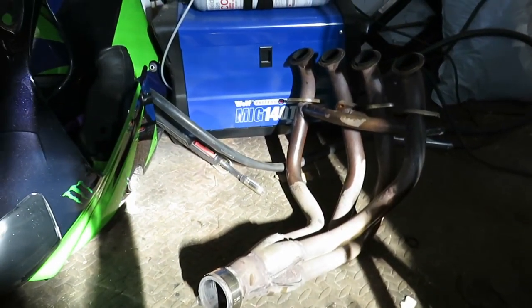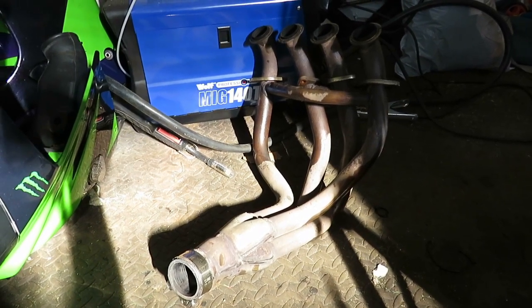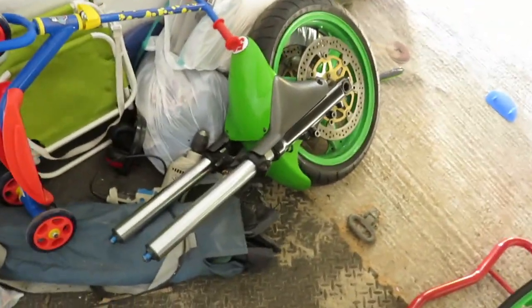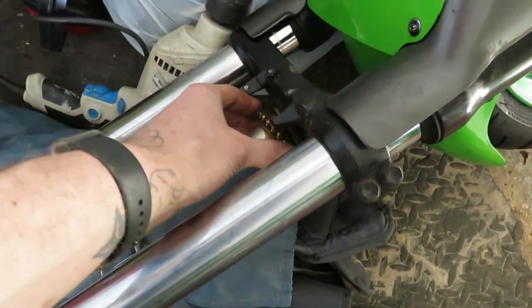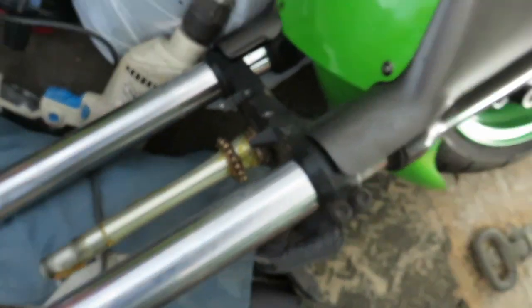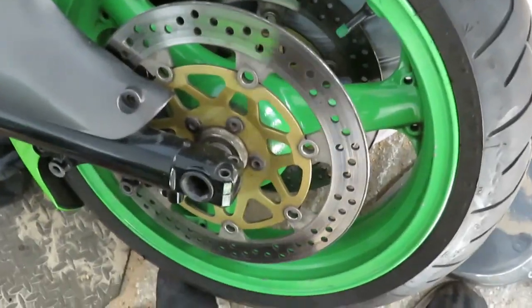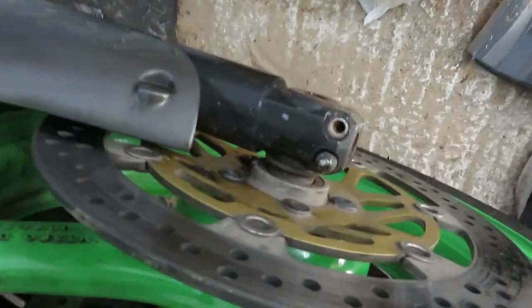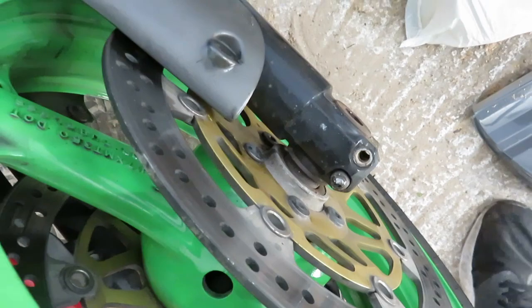What I can start doing is polishing them down. Use a fine wet and dry, I think they might just polish up anyway, I'm not sure. And then what I'll do, I'll take my forks to work, take the bottom triple tree or yoke, whatever you want to call it, off to get this race out of the way and press the new one on. And also I'll get that off there and get some new pins ordered. So for now,